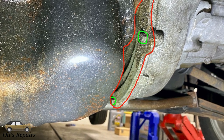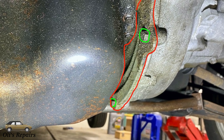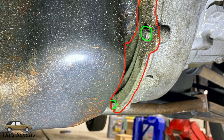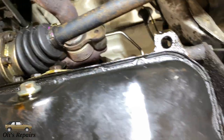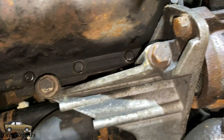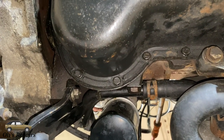Here's a quick picture. The plate outlined in red actually needs to be removed before we can get to the oil pan bolts. That's done by removing the two screws which are circled in green. Once those are removed, remove the plate, and then you can get to the oil pan screws — all 20 of those.